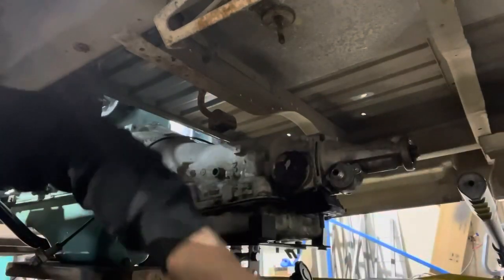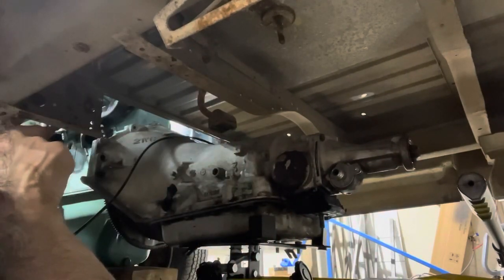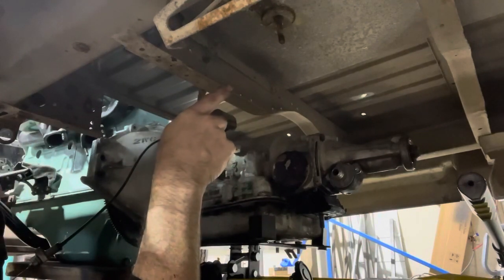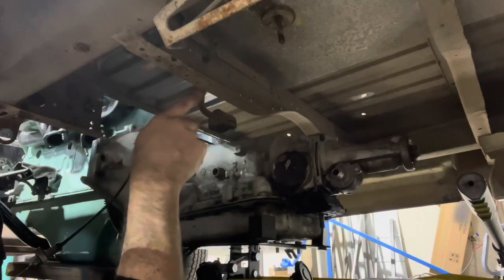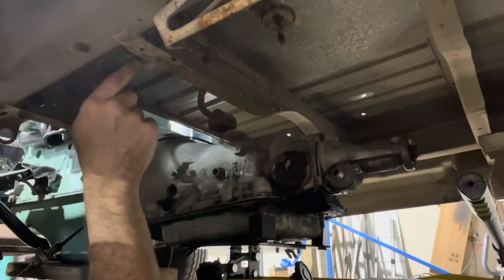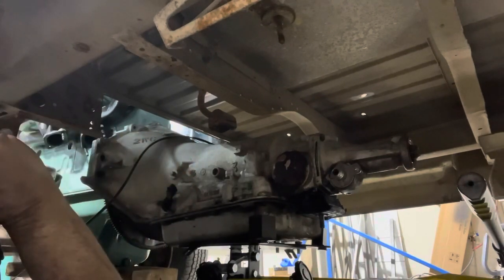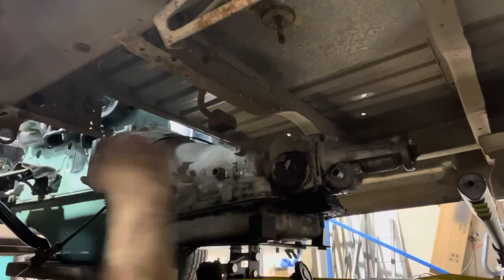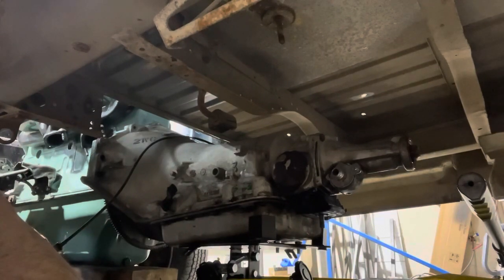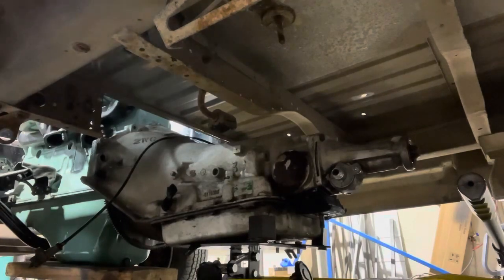Well, I think what I'm gonna do, got a bolt there I need to grind off. I think that's up in the bed. And there's a heat shield there. I'm gonna pull that off. I'll have to get this bolt out to do that, and then just cut that other one, well, measure first, make sure it's going to fit, but I think we'll cut that other one and just see how it would look in here. It sure would be easier to put that other one up in here, weld it here, throw the factory cross member piece in and be done with it. So let's do that and see what we got. All right, we'll be back in just a minute.